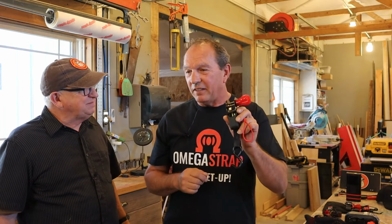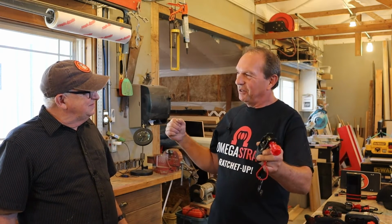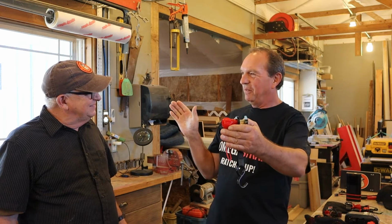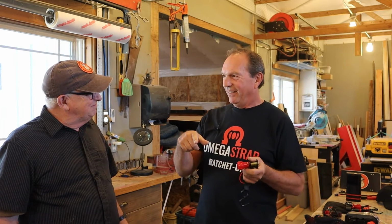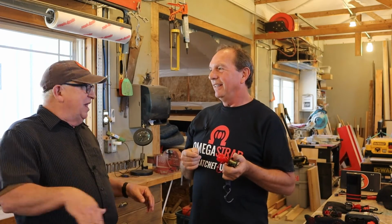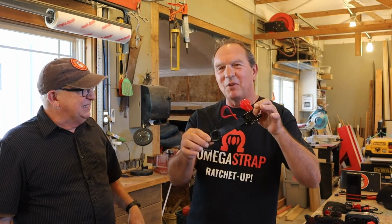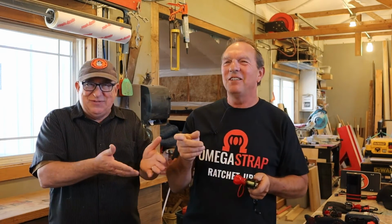So not only that, but I did let those down. I took a third strap, the transmission, I pulled it back to the axle, cranked it back, so I had about that much room, replaced the engine seal, and then just cranked it back up. And voila. Went the other way and it was all done. I'm sure the straps are a little dirty, but they did the job and they were clean. They were black. That's right. There's a reason for that.